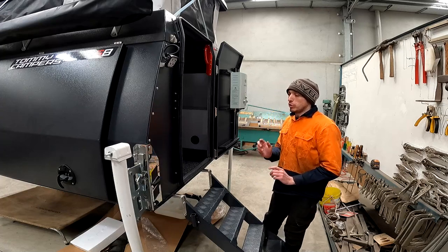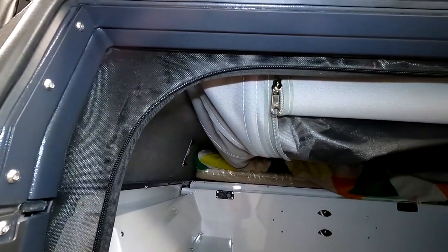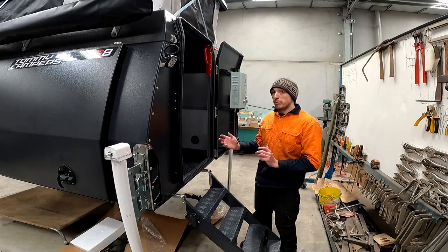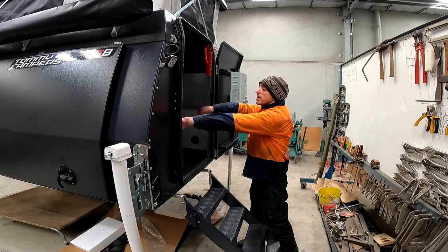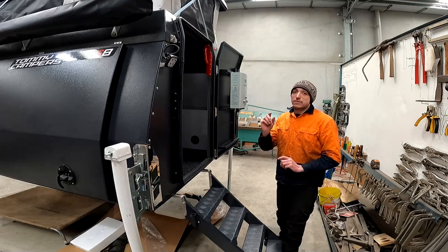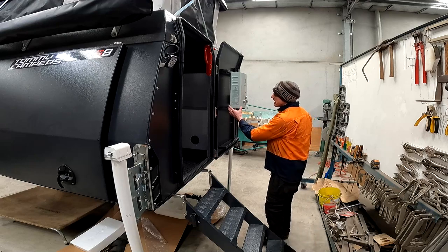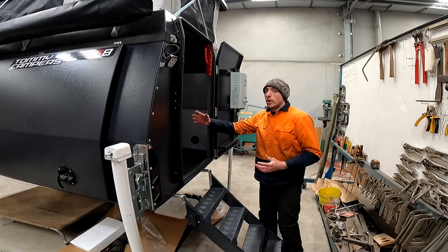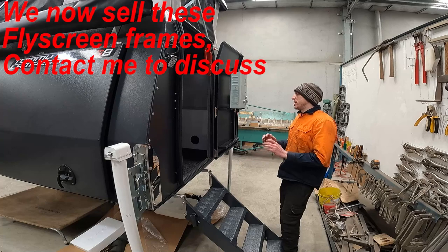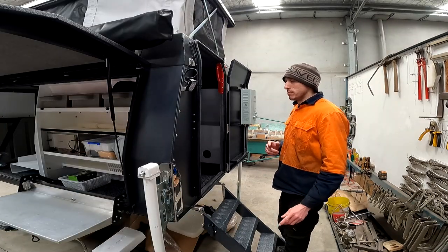So what we've done is come up with a design where we make an aluminium internal frame that goes around the inside of the door opening — all the way from the bottom of the sides to the top — and we utilize the fly screen that comes from Tommy Campers, which just clips around the internal frame. The good thing about that is you can then open and close your door without pulling the fly screen on and off. Even better, with the hot water system sticking out from the door, we have enough room in the doorway — because the fly screen is pushed further inwards — that we can fully close the door without even opening the fly screen. That's a massive time saver.